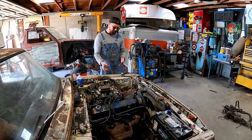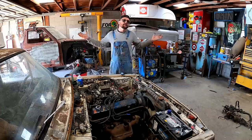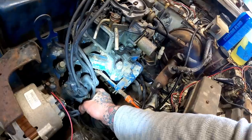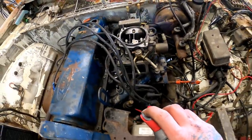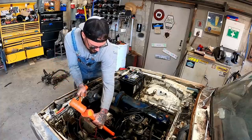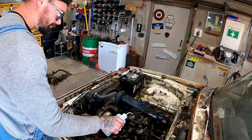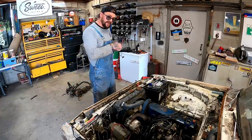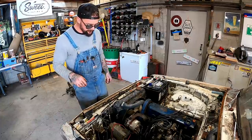Maybe a safe bet to loosen the distributor, because if the firing order is 180 off, we don't know what's going on. We can't assume she's got good timing, is what I'm saying. Loosen her clamp down in there. I ain't managed to spin it yet, though. She spun a little bit. She just don't want to spin very good. I'm gonna put this thing down, flip it, and reverse it. See if I can't get that distributor to work yet.